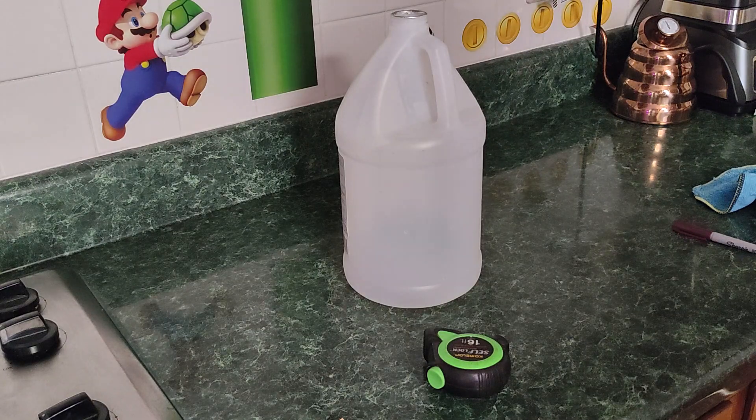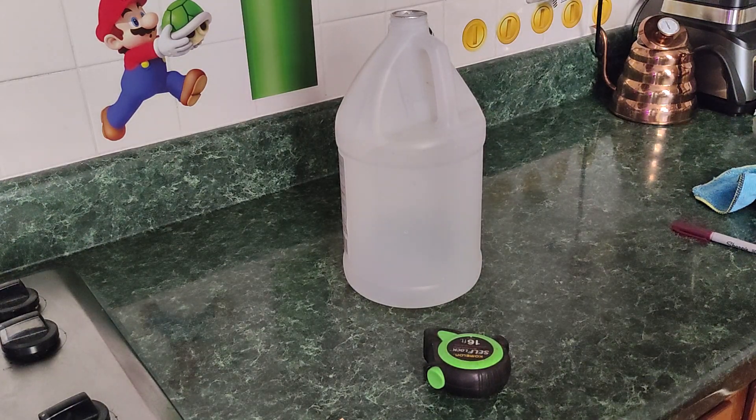80-20 and 50-50 are pretty common. If you want to run 100% methanol, obviously you just put 100% methanol in. But 80-20 is a good one. The reason you might want to go with 80-20 instead of 50-50 is a little more methanol content. More methanol is more octane. Water is very high octane because it's not flammable. But methanol can burn, so it's very high octane — I think it's around 120-130 RON, like the numbers you see at the gas pump. Nobody quote me on that.